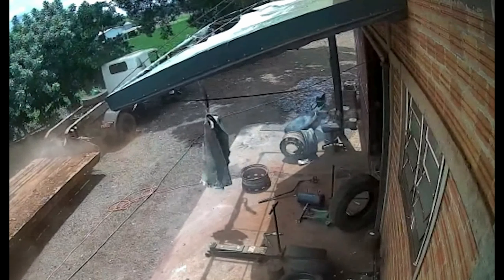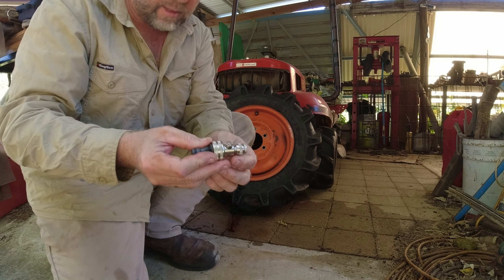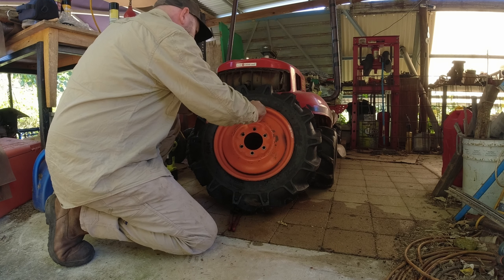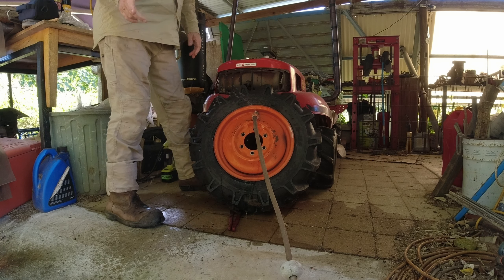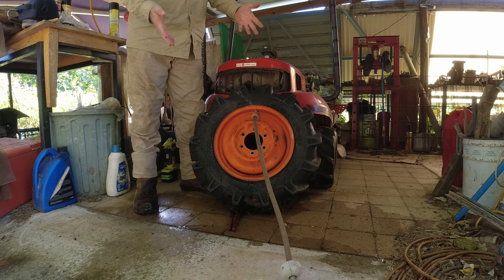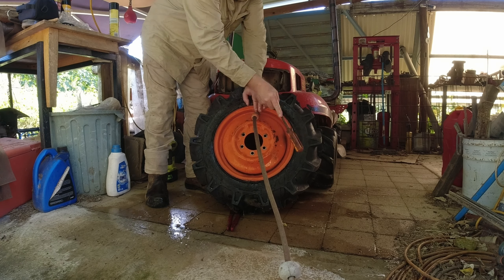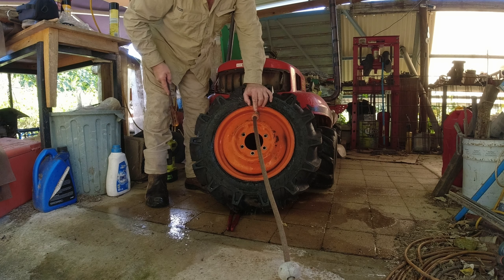Maybe that's what this little button is for - letting the air out. We've got 25 PSI in the tire and town water pressure would be 40 PSI - this is just a pump on a long run turned down a bit so it might not be enough. The incoming pressure needs to be higher than the pressure in the tire. Interesting to see if the pressure has changed after this - in theory it should, though I am letting a little bit out here.